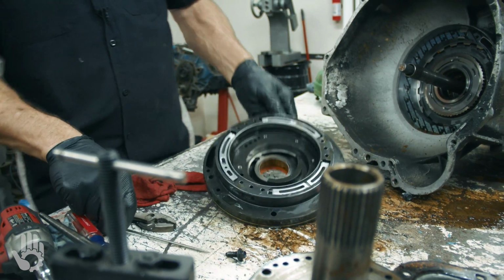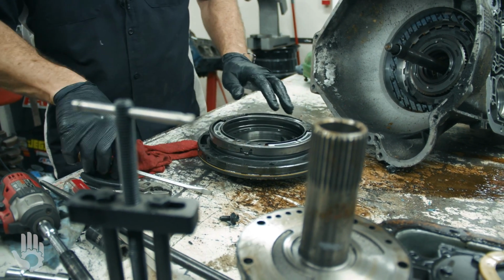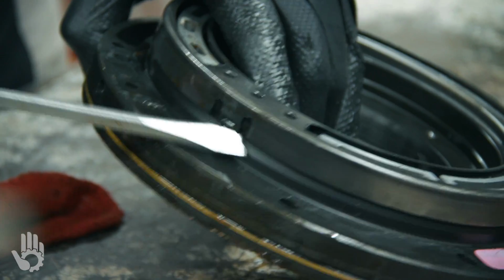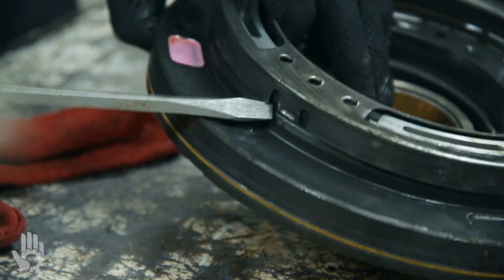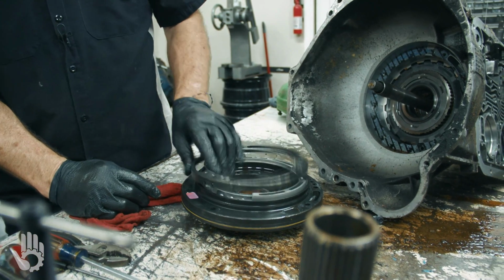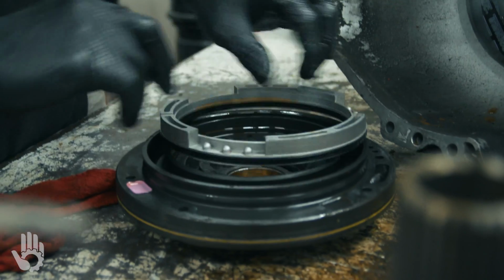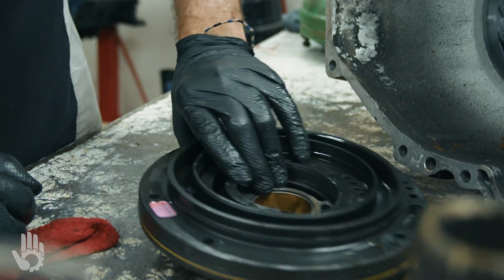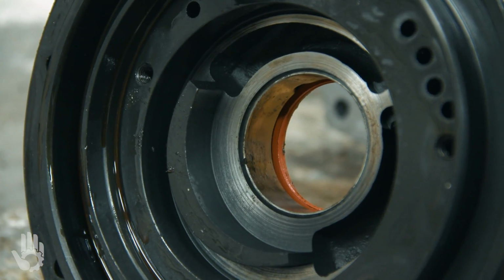Okay. Just so you know, on the back side of your pump right here, you've got a set of springs, okay, and a piston. That's for the intermediate clutch pack. The only thing retaining this is 3 little tabs here, okay? And what you do is come in here behind that retainer, bend those out just a slight bit, and then peel this guy off of there. He lifts right off there. It goes back together, just literally snaps in place. And then our piston that goes in there for the intermediate clutches has 2 lip seals on it. Bushing and seal, of course, we just automatically replace when we rebuild the transmission.